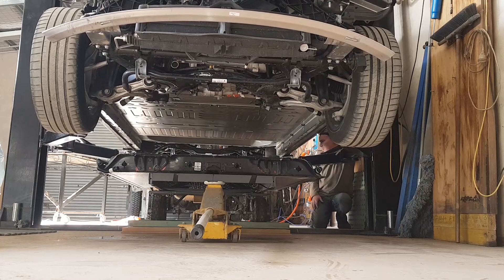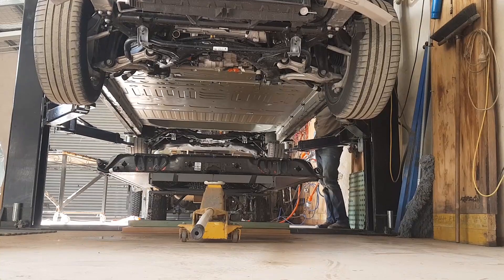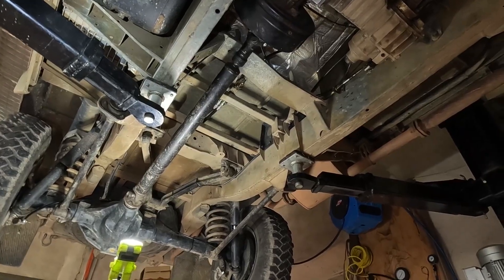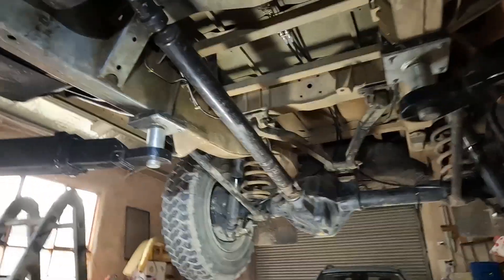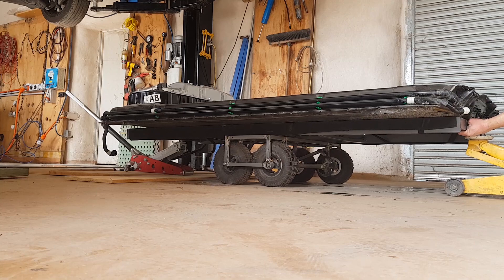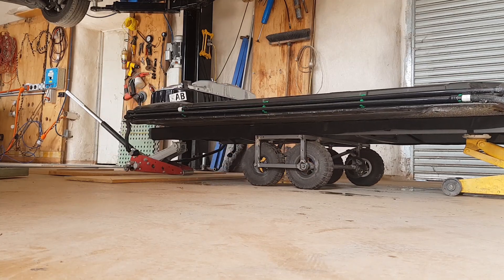I need to be able to fit this battery somehow into the Land Rover. Ideally I'd leave the battery packaged in its original casing and mounted in the Land Rover somehow. But the Land Rover was never really designed to fit a battery this sort of size — there's not enough room between the chassis rails, and not enough room above the chassis rails and below the body. So I'm going to have to reconfigure the size of the battery to be able to fit it.